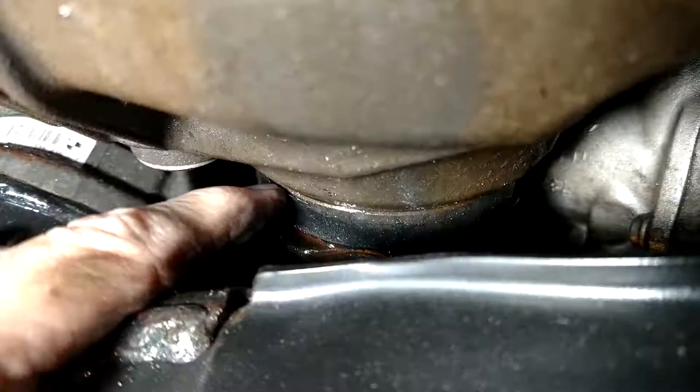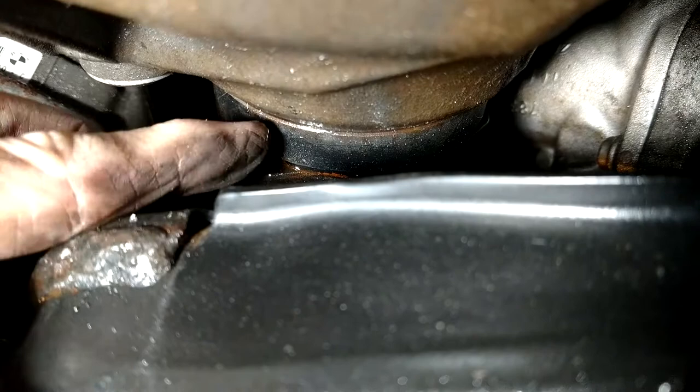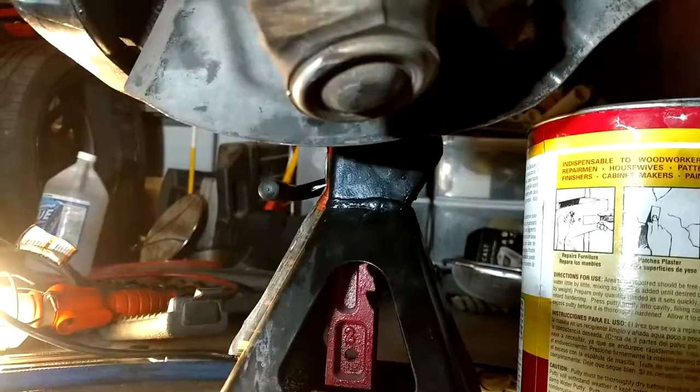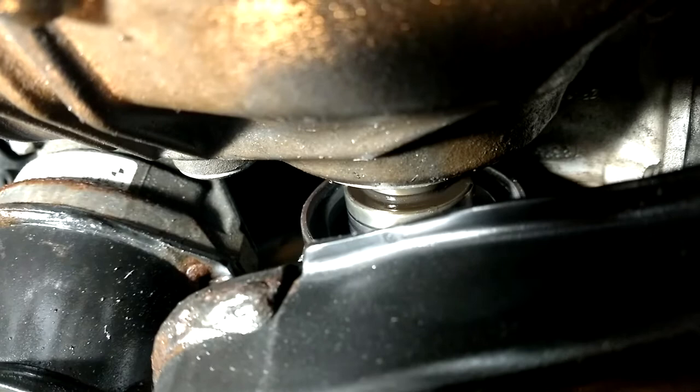There's the inside of the CV axle and the differential, so I've just got to push the CV axle out that way. This will be accomplished with a pry bar and a love tap with a hammer - should pop it right out of the oily nasty broken differential. I nudged the axle with a jack stand to get a better angle on it, made it a little easier to push out.